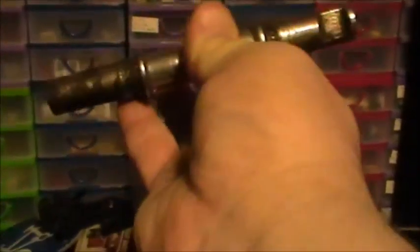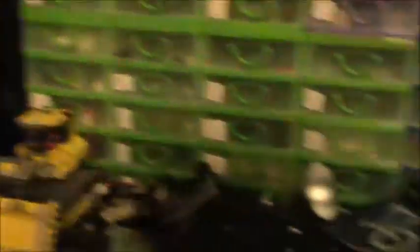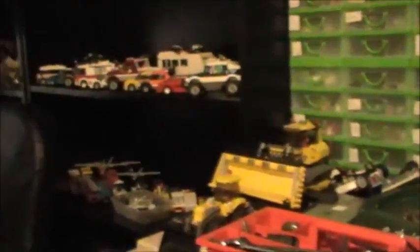I've just got to remember that there's a right and a wrong way to put these in. If you look — the left side as I'm holding it is actually longer than the other side. So that's your drive side — that's what your crank's got to go on. So I've got to put it in long side first. Obviously with some bearings as well — it ain't going to work without bearings. Well it will, but probably not for very long.